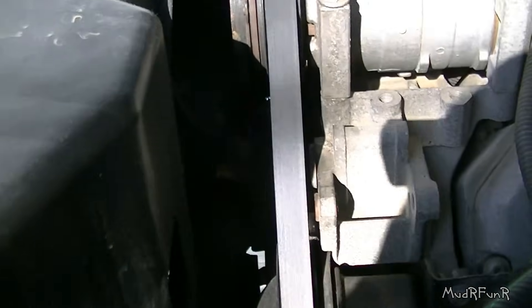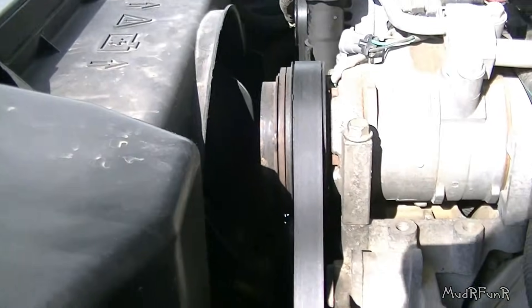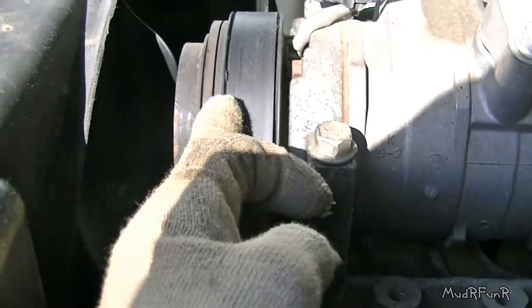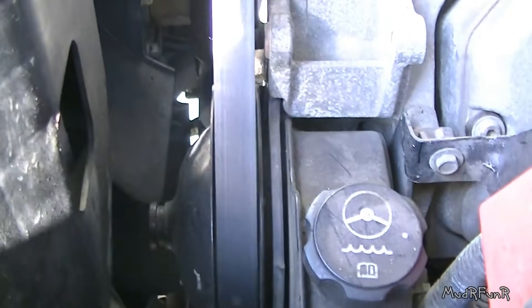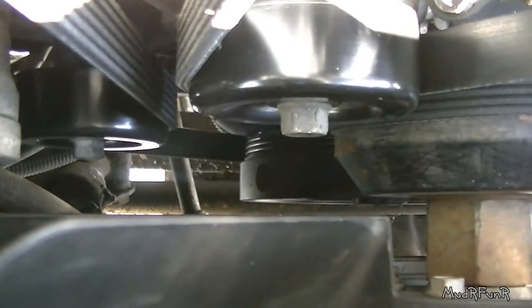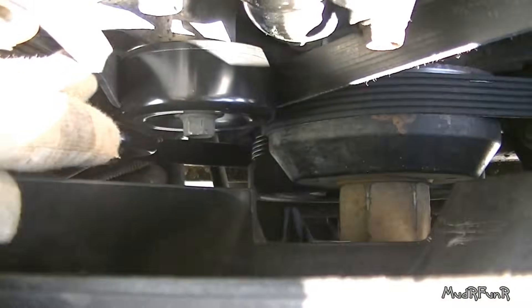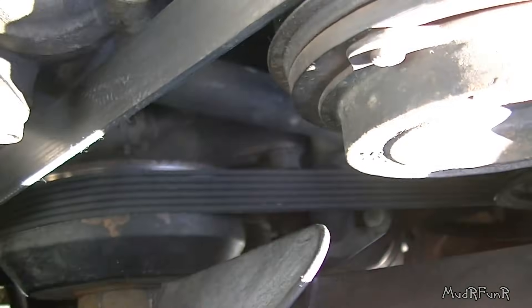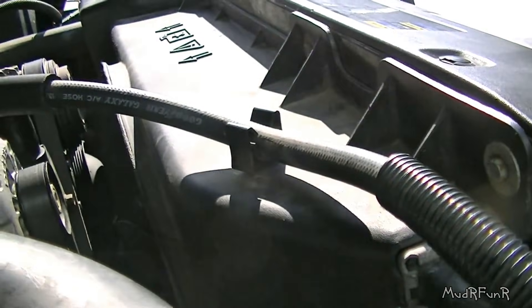The last thing you want to do is make sure that everything is in place where it's supposed to be, and especially make sure that all of these grooved pulleys have the belt in the teeth. Make sure that the belt hasn't jumped over a tooth or a spline. Make sure that it's in place on the crank, because that's usually the first place it's going to come off since it's hanging from the bottom. Sometimes you've got to get underneath to have a look. Make sure it's sitting nicely on your idler pulleys in the middle and same with the water pump.